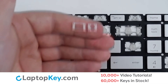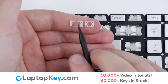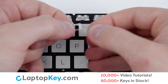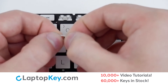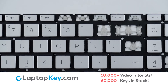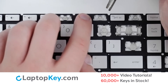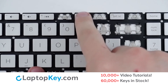To reassemble your clips, we'll begin with the top clip which has two long holes at the bottom and two thinner ones at the top. For the bottom clip, the slightly rounded edge and two holes will be on the top side as well. Unlike the standard and wide set keys, these clips do not need to be connected at any angle, so simply line the two halves together, small press on either side, ensuring the plastic arms go into the holes. Then using the metal hooks, lay the clip down bottom first, small press at the top, place the keycap back on top, and we are functional.